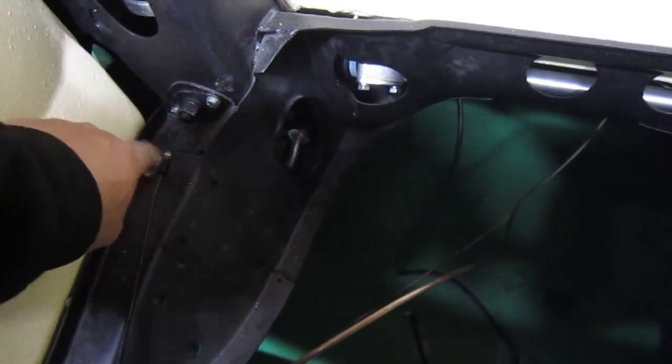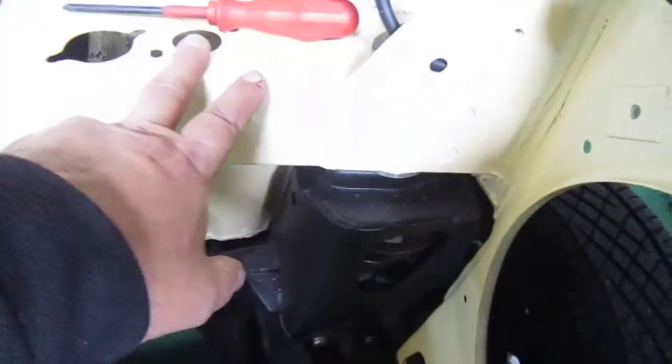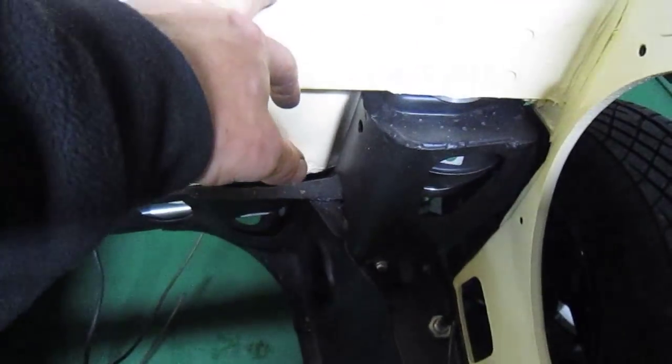Put the new brake balance on. I've got to make this union up here. The banjo I'm just painting at the moment, well, the two-way which goes onto this banjo union, and there's the line in the front, you can see going around the subframe. Obviously we'll put the calipers and everything on first. We'll do as much as we can. This blanking plate for a left-hand drive I've just done now. You can see that. Car's looking really dusty though, I have to say.